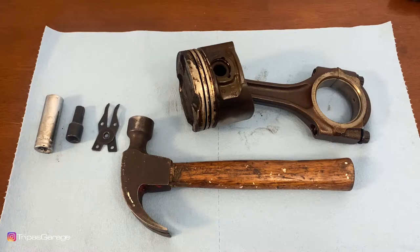Welcome back. Today I'm going to show you how to remove the piston from the connecting rod on these two JZ pistons and rod combo. I'm sending my block off to the machine shop to get it honed, and I want to make sure not a lot of material is taken off and the piston-to-wall clearance isn't too great. I'm taking these pistons off to get them cleaned up so the machine shop can take measurements and let me know if everything's within spec or if I need to purchase new pistons and have the block bored out.